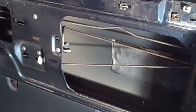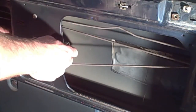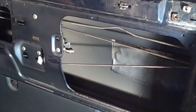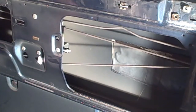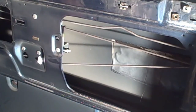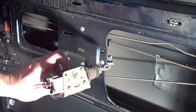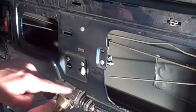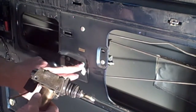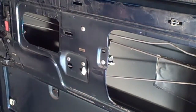Our door lock actuator is sitting right here. You can see when you move this back and forth, this is supposed to lock it, but it's just not doing anything — barely moving at all. See how it's completely stuck, so we're going to have to drill out these rivets to get that out. Here is our other door lock actuator that we're going to be using. You can see where the rivets are — one here and one here. And it just sits like that, so we're going to remove this.